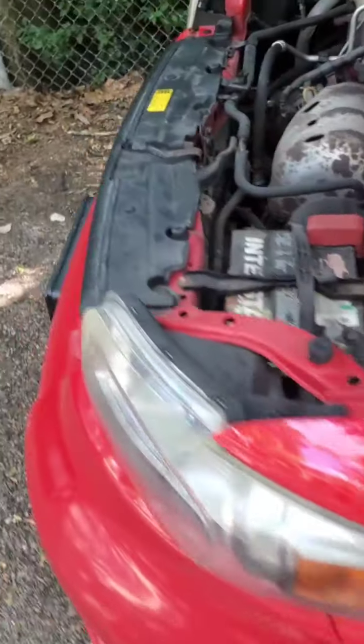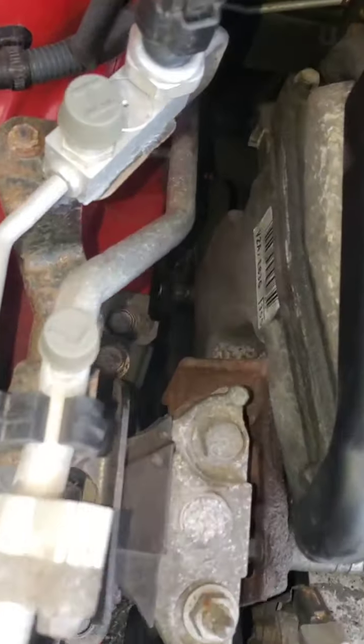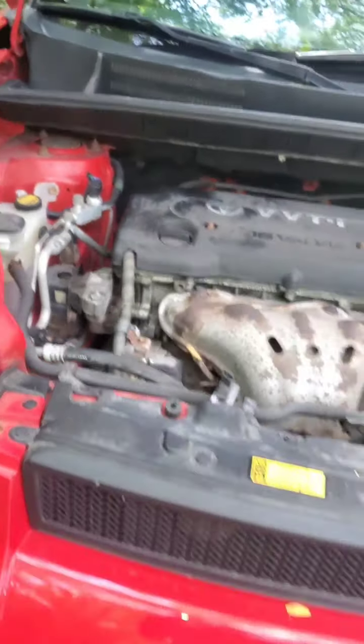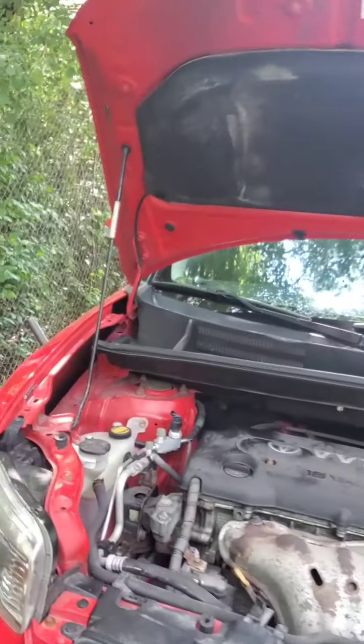She's alive — hell yeah! Common issue: stupid pulleys and the tensioner. You do not need to replace the whole assembly — nobody's trying to pay 350 dollars for a little spring. There's plenty of tension on this; you can feel it when you try to take the tension off to get the belt off. Obviously if the tensioner drops down with no effort, you know it's bad — but if there's resistance, you're good. Hopefully this helps you guys.